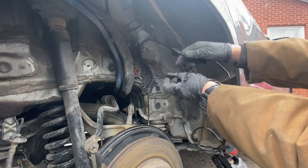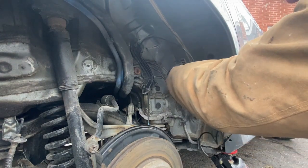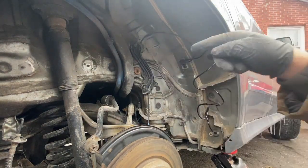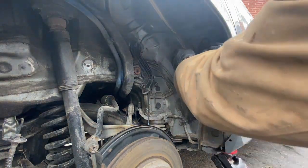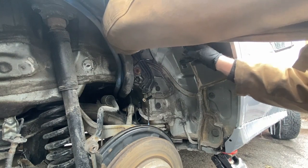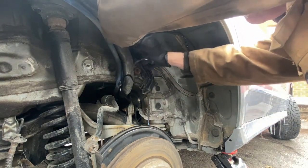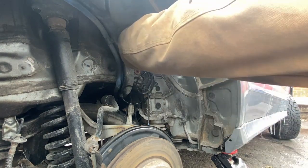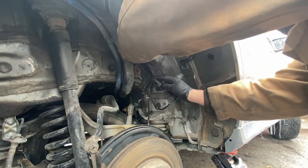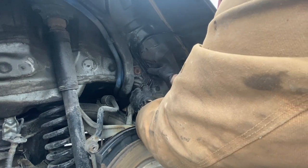Just a bit of synthetic grease on the rubber seal that goes around the lip of the connector and the ABS connector. Then this one notches into the other one and they click together like that. When you push in, that little spring wire tab should pop back out and lock them in place. Now simply feed this down the channel — it clips via rubber grommets into the slots.